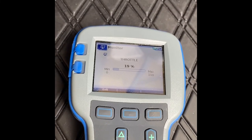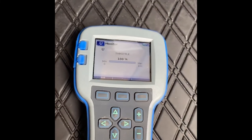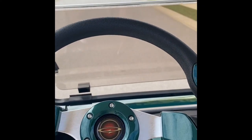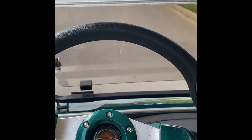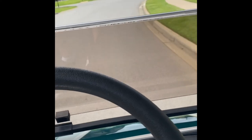Let's check the readings — make sure it's in neutral, foot on the brake. At zero, and as I start to accelerate, I'm reading 100%! That did the trick. 100% throttle runs a whole lot better than 77-78%. On this 2006 Club Car DS, speed code 4, we're doing about 19 miles an hour — not too bad. Hopefully this helps out, good luck!